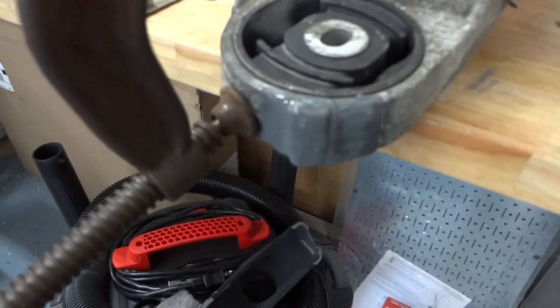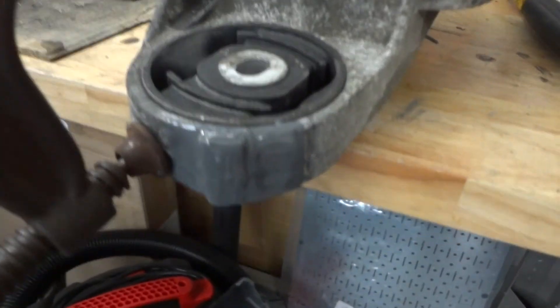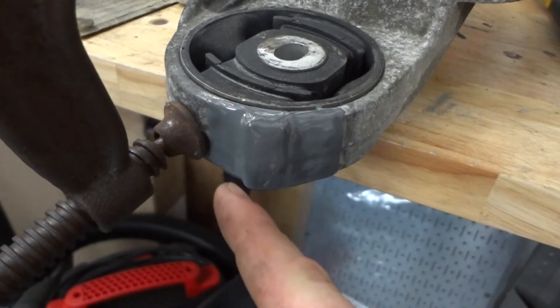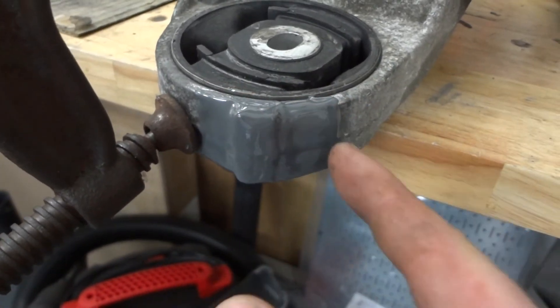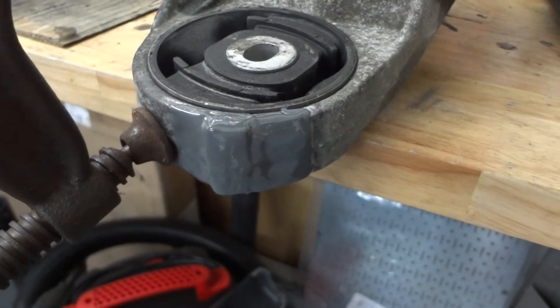Here's what I ended up with: I was able to close the gap with a C-clamp. The JB Weld crack is right here — I've got it spanning this extrusion. Hopefully there's enough bonding on both sides and the surface over here, and I built it up just right above where the crack is. So we'll see how that does.